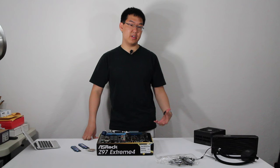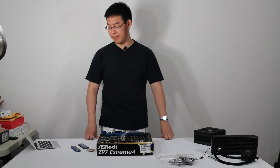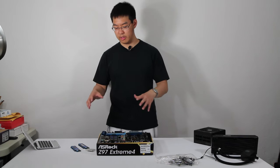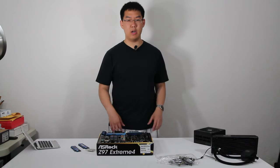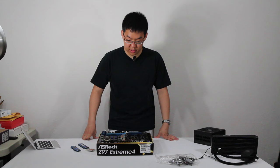I'm going to do that, and then see if it posts — which basically means if it turns on. If something doesn't turn on, I'm pretty worried because that means something is fundamentally wrong with the system. The CPU, the RAM, and the cooler are the bare basics that the computer needs to run, and if that doesn't work, we have some issues.